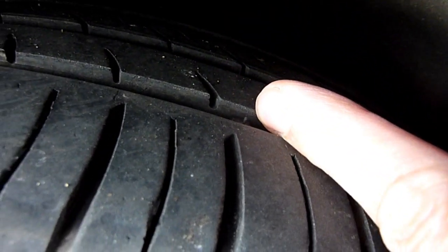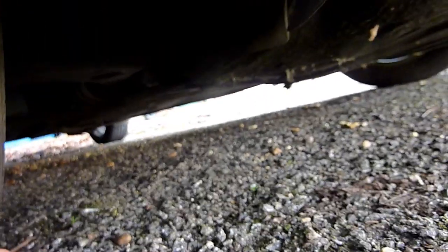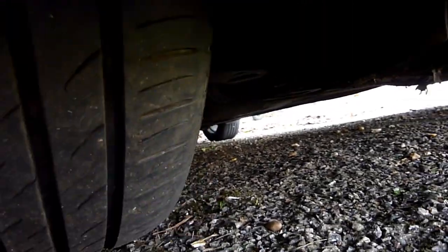Check that you've got enough tread depth. If you look, there are usually little nodules in the tread — those nodules indicate the lower legal limit. Mine's quite low and you can barely see it. If the tread is worn down to the nodule level, that's below the legal limit, which is 1.6mm in the UK. Check for even wear across both shoulders of the tire — if it's badly aligned you'll get wear on the inside or outside.